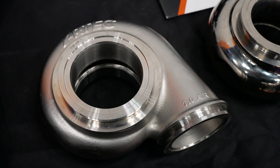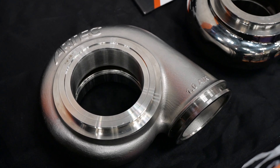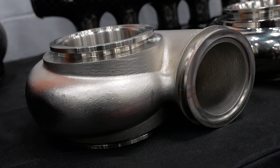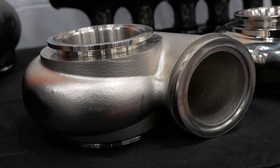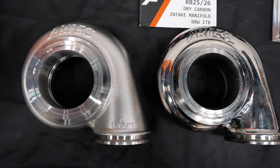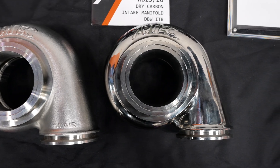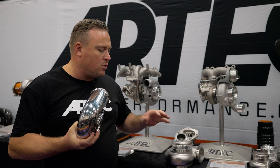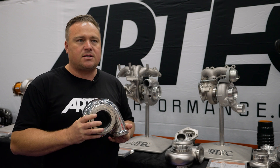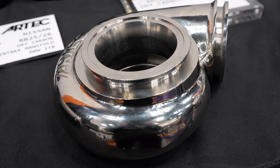One of the interesting features we're displaying is the new 70mm V-band turbine housings. That's fairly new, but it's not super unique — these fit our G45s, G42s from Garrett, as well as Precision 75, 80, and 85mm turbines. But the big thing for the show, which is something we've been working on for quite some time, is this shiny one. This is a full titanium turbine housing made off our moulds for the stainless ones. It's quite a complex process, and in terms of weight savings, you're looking at about a 50–55% reduction in weight over stainless.